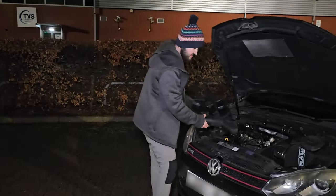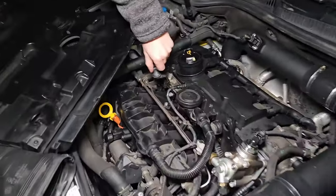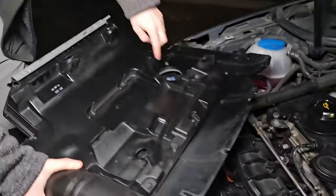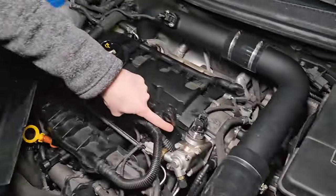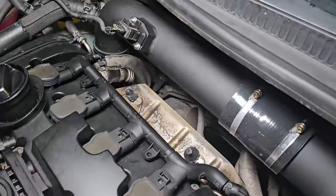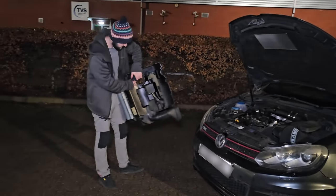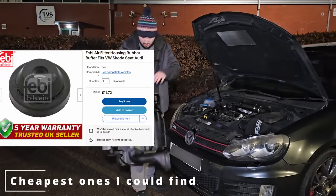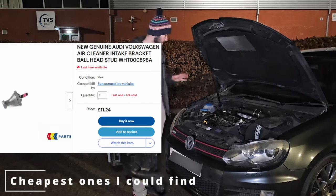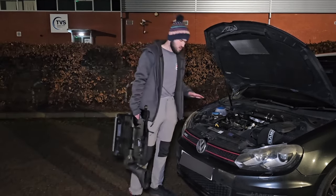The reason is how they mount — they mount onto these pegs and there are little grommets inside every hole. There are four holes: one, two, three, four. There's one peg here and two in the back. The issue is that as the car heats and cools, the plastic eventually gets brittle and the pegs snap off, and the grommets just disintegrate. A set of four grommets costs almost £30, and the pegs are almost £50.